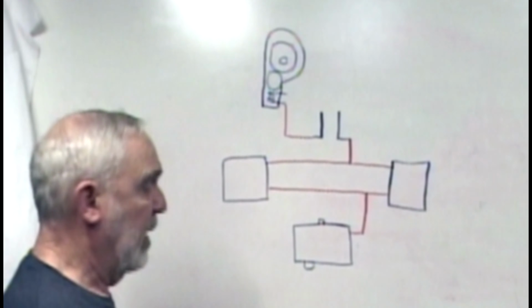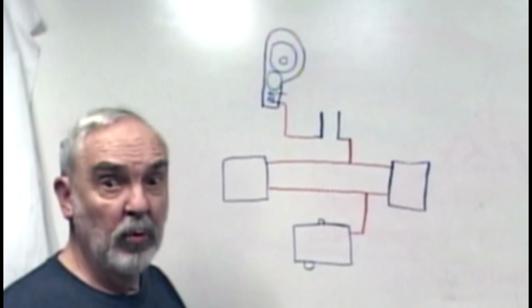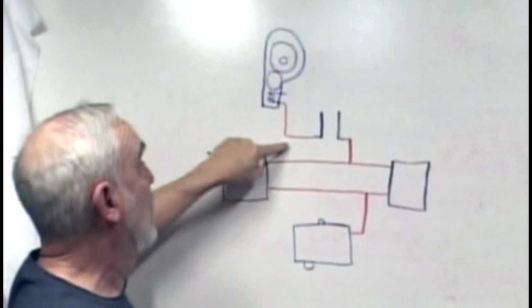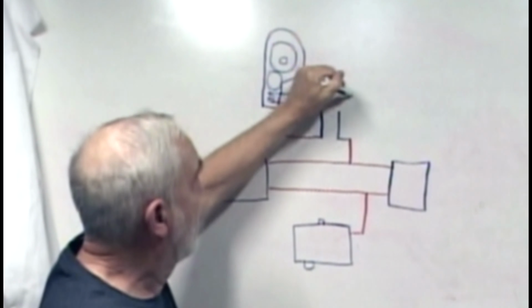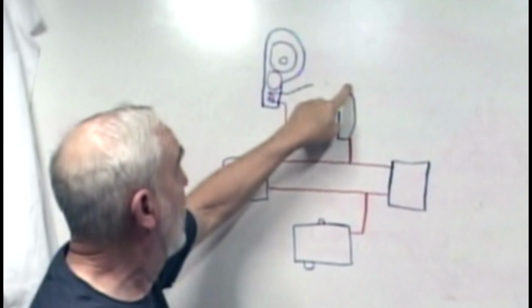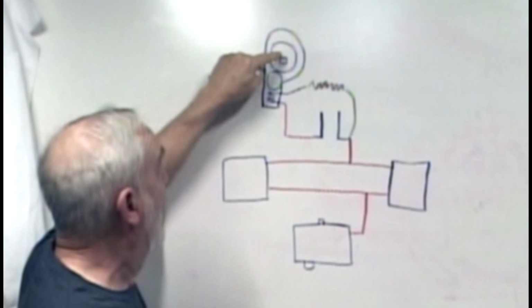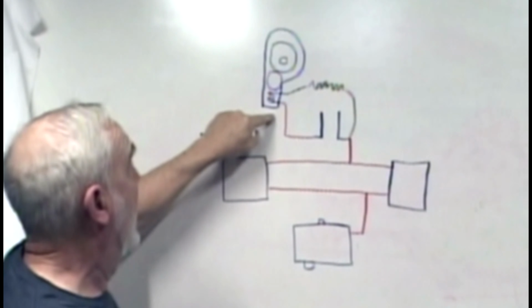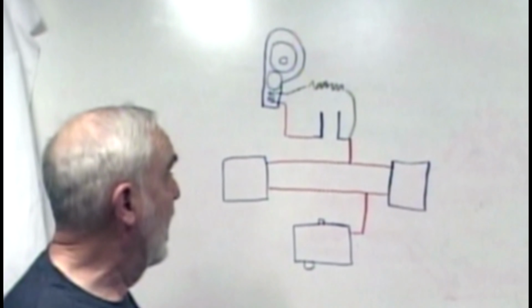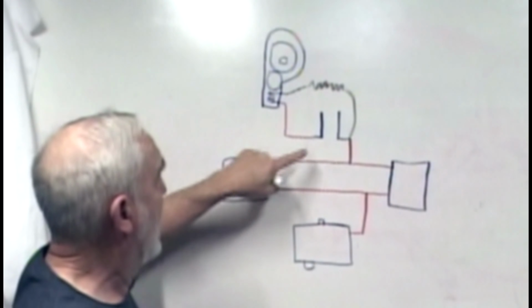And I can start to draw a path, but I'm going to change 2 paths. One is the motor has got to be on continuously, so it will not go to the switch. The switch turns things on and off. I want the motor on continuously when it's plugged in. And the way that is done is it is connected to this outlet, part of the outlet, and this outlet. This is a very small motor. This is 120 volts. So they will put in, and I'll show you this in a second, a resistor that lowers the voltage and that's going through here, so the motor doesn't burn out. If I hooked it straight in, the motor would burn out, much like a flash bulb would burn out. The other connection, upon examination, is to take the electricity from here back to the outlet.